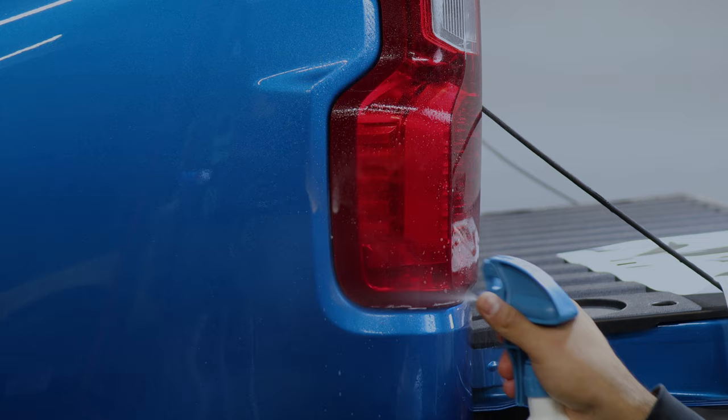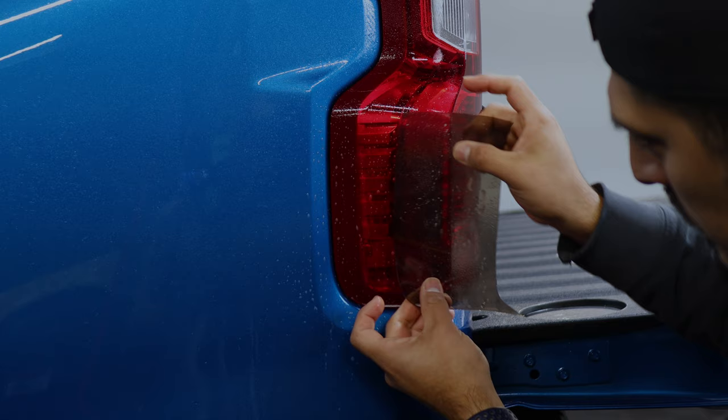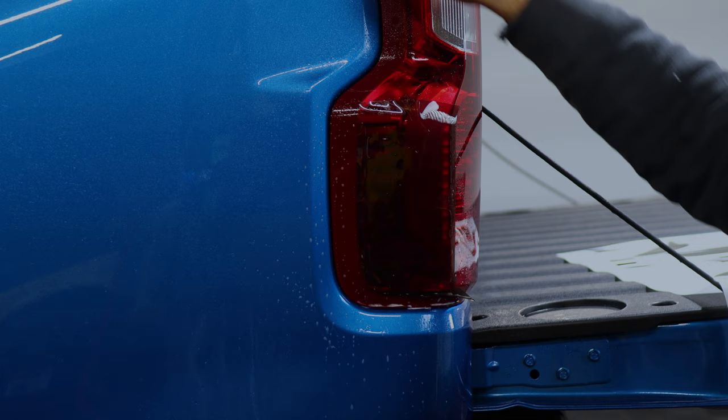You are going to notice that the taillight has a two-tone red color. You want to align the edge of the tint to where the two-tone is about to start changing color — roughly around there. That's to align to where it's about to change. This piece right here is going to get covered by the other piece of the tint, so it has to be aligned right there.